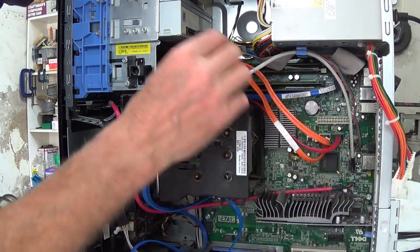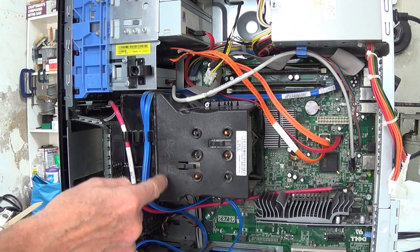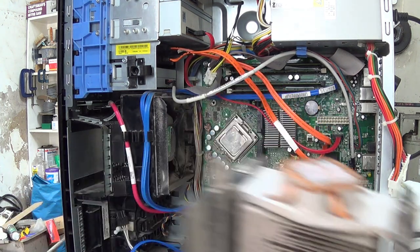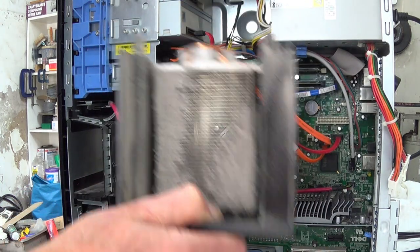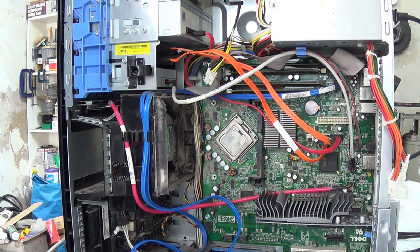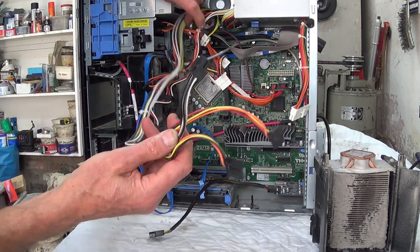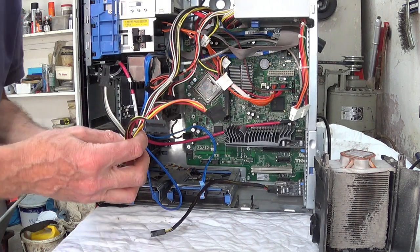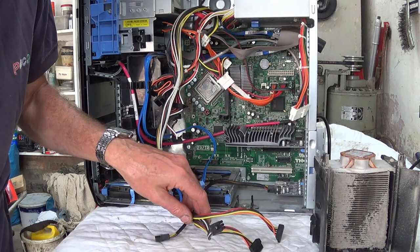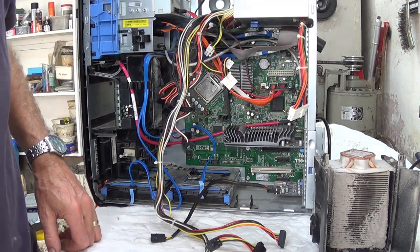Those are clear. But there's a loom that runs down the back of the fan — the CPU fan housing — so I've just unscrewed that with two screws. I'll disconnect those and come back. After a bit of a fight and struggle, I've got this loom out, which ran right down the back of the case and out between these two disk drives. We're ready to now remove the power supply, which can be done by pressing this button here and also removing some screws on this side panel.